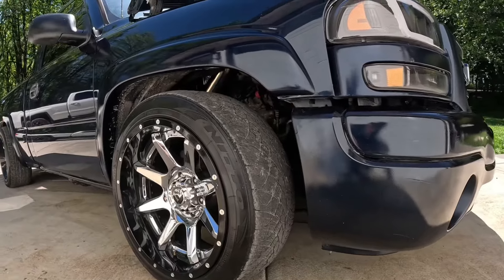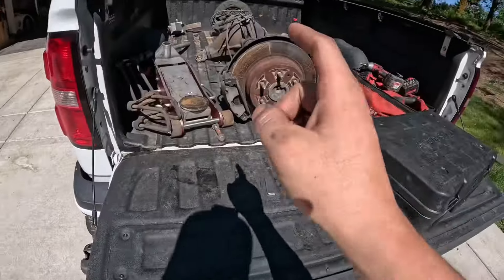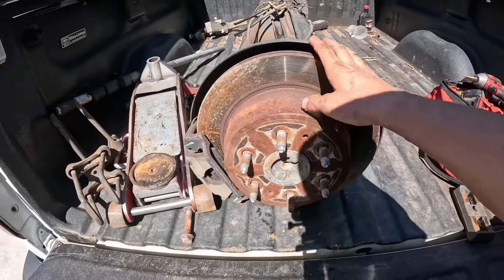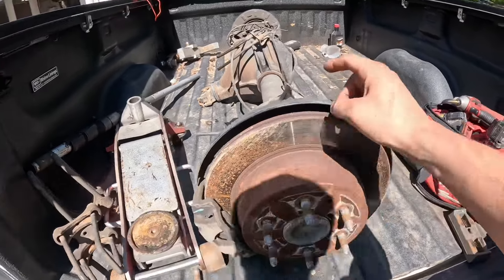She's looking fresh. I'm just overwhelmed with excitement for this truck. Been ripping it here and there — it doesn't like to hook in fourth gear, which tells you it's pretty good. It's got a stock 10-bolt in the rear; it's gonna break if I push it too hard. So I did buy a 12-bolt — the truck has 3.42s and we're going to a 3.23 with a nine-and-a-half inch big boy. It's basically the same as a '99 to '06 14-bolt, just with 12 bolts on the cover.